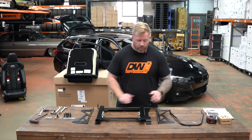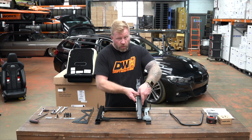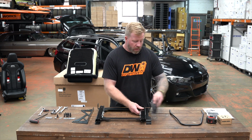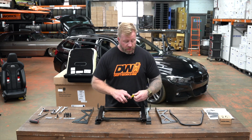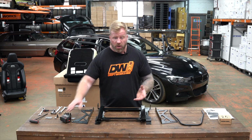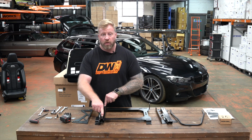I know it's 390mm. If I sit my side mounts up and line the holes, which you might be able to see there, to the very left-hand edge, that is in line with the side of the slider. So that gives me an idea that, from a rough estimate, if I know that it's 390mm, the seat's going to come to the edge of there. I can measure from that edge to that edge, and that'll give me a good starting point. If I lay that on its side or upside down, I can see that, yep, I need to use the second hole and second hole. So second hole in on both.